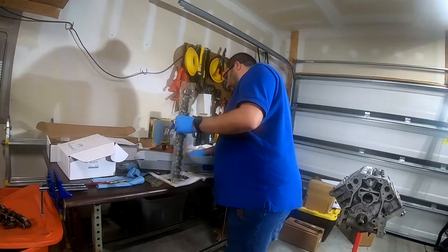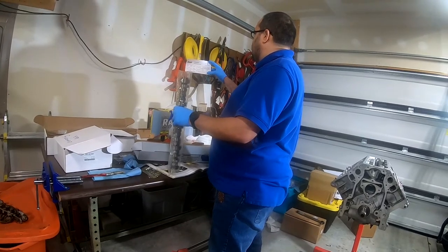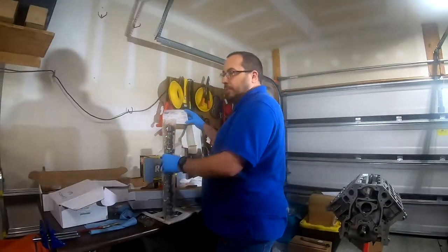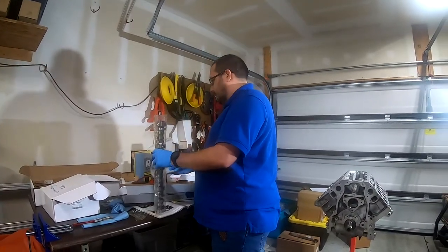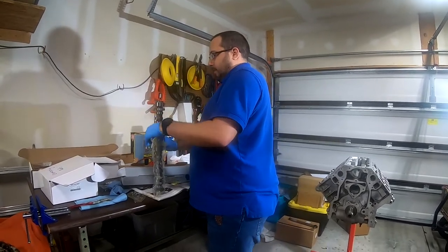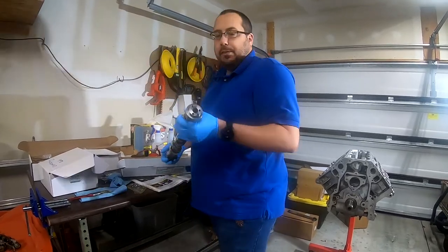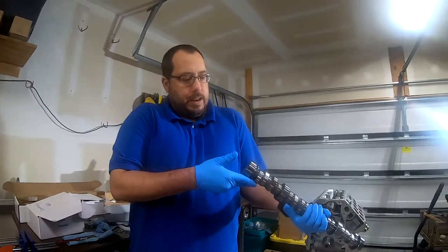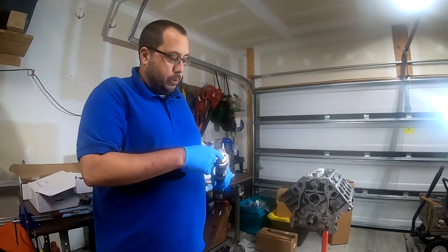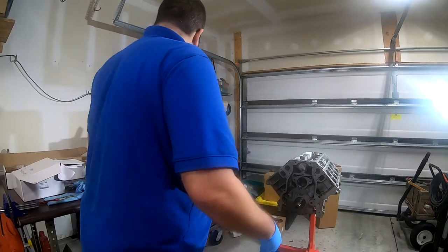And then in the box, they give you some nice stats about it. It's an LS1 cam, which clearly you could use on any of the LSs, depending on what you want performance-wise. So now there's a few differences between this and the stock for my LC9 engine. The stock was a one screw, center screw, but this clearly is three screws. So I bought the screw kit to make that work.